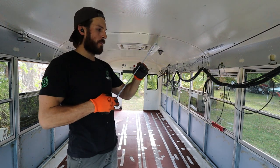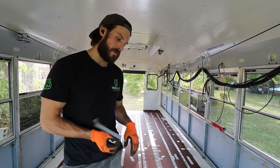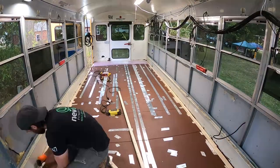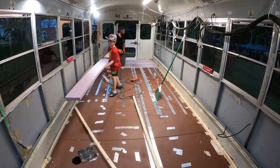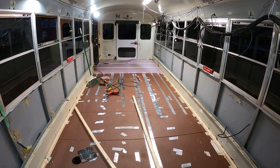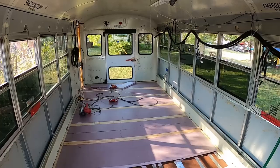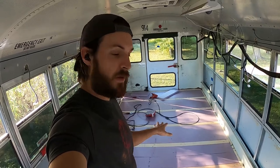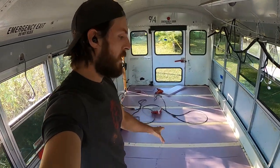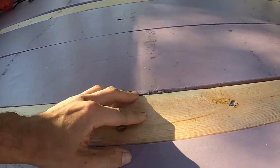We're at about four-and-a-half inches over my feet, so it will go up two inches — still leaving two inches of headroom since the client is about the same height as me. So with all that said, let's get to laying some floor. We're on day five now. The process is two-by-fours down the middle with two-by-twos on the sides so the OSB has a spot to rest all the way around, with roughly 20-inch gaps in between.